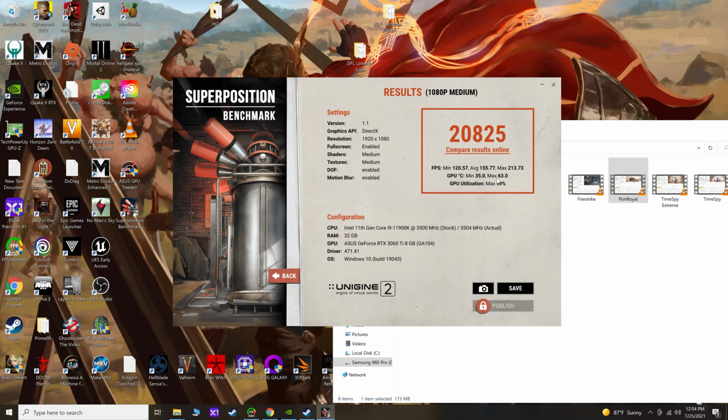I think that test is about 5 minutes or something like that, but it's all one test pretty much, where it isn't stopping between tests and allowing the GPU to cool down briefly before it heats up again. So it looks like low to mid 60s on this card seems to be a pretty safe bet. But like I say, after an extended period you might get close to 70, but not too bad.